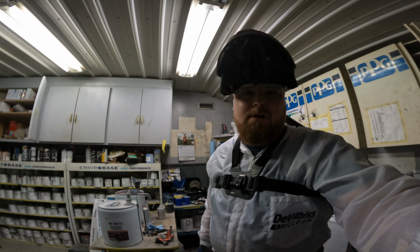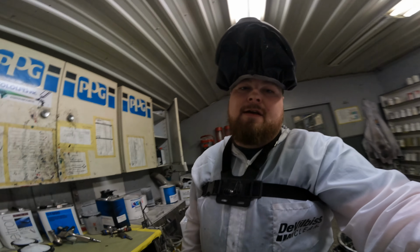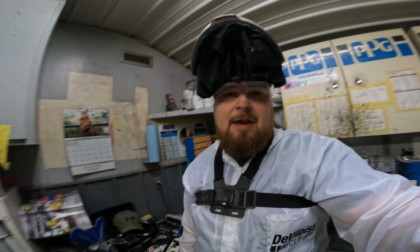Do not put your first coat of clear on too heavy, guys, because if you run it, you're gonna pull them pearls right down. That's just a little bonus tip for everybody. But yeah, we're gonna get clearing this car. I'll see everybody when it's done.